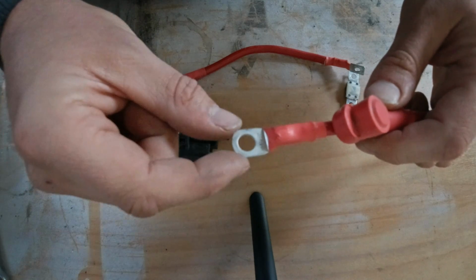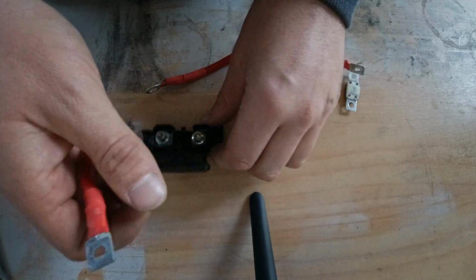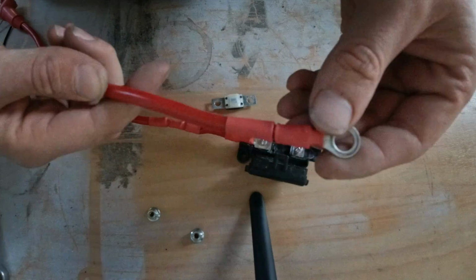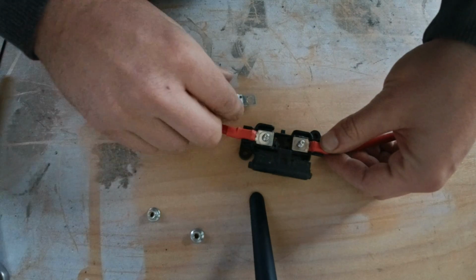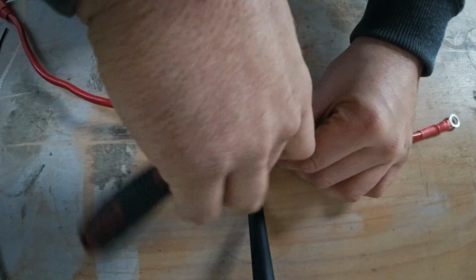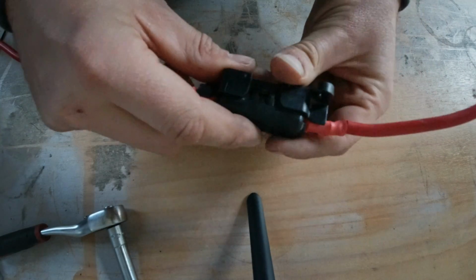This is going to go onto our SBI itself. The other end is a nice little one, which is what's going to go into our fuse holder. Perfect fit. We'll undo the other end. So same again, we've got that fat end, and that square end's going to go into our fuse holder. The 60 amp fuse can just sit on top there. Bam, and we'll crank that down. Don't want to crank them too tight, just shake it a bit, get it on there, clack it shut.